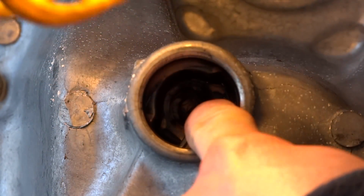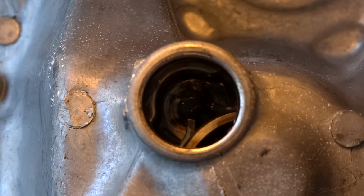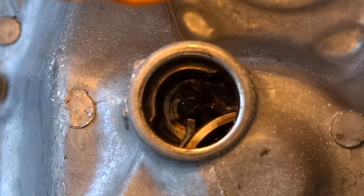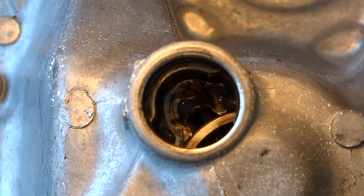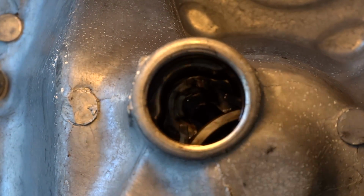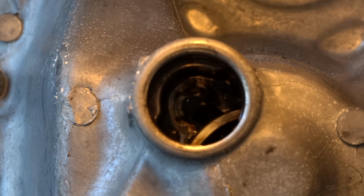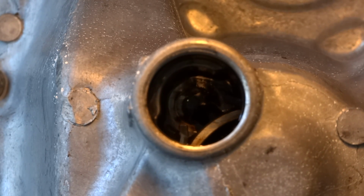Alright, so here's a snap ring right here, as you can see. And all you do is separate that ring, and then we'll take the 12mm bolts. I know I've been saying 10, but they're actually 12mm. And all you do is just stick either a pair of needle nose pliers or snap ring pliers in, and you just want to separate it until it's out of the groove, just like that. See how it's really wide right here? Now that's separated, and all we're gonna do is take these 12mm bolts off all the way around, and the brackets, and this casing should come off.